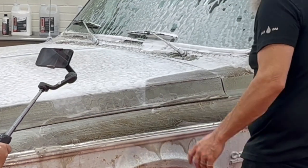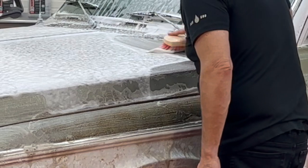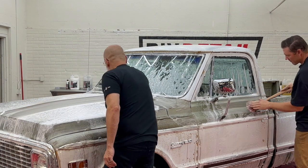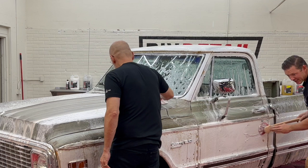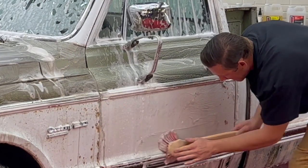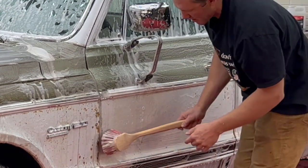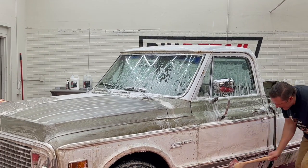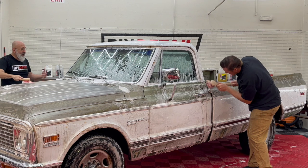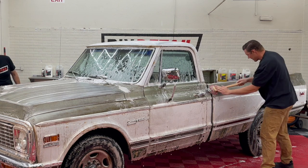As Zach mentioned, we don't necessarily want to remove all of this — I just want to remove part of it, make sure that it's clean, but we're not trying to remove the patina; we just want to level it to a certain level. As you go, just keep an eye on it. Sometimes I'll remove some of the soap just to see what I have going, go back at it, check it a couple of times. If you just sit here and scrub, scrub, scrub, you may get to where you have great paint — if that's the look you want, sure — but some guys want some of the surface rust to show. That's the style a patina truck gives you. The brush is soft enough that on the good paint it's not going to damage it, and on the patina we're just taking off what we want.